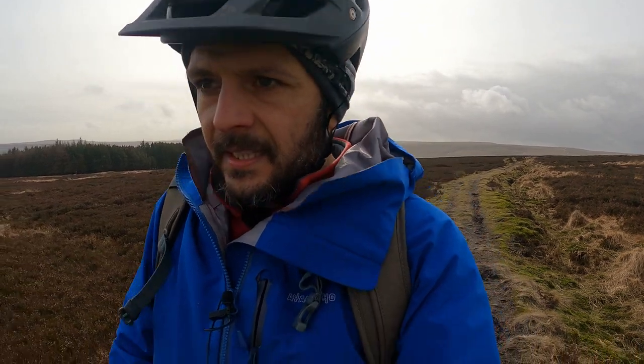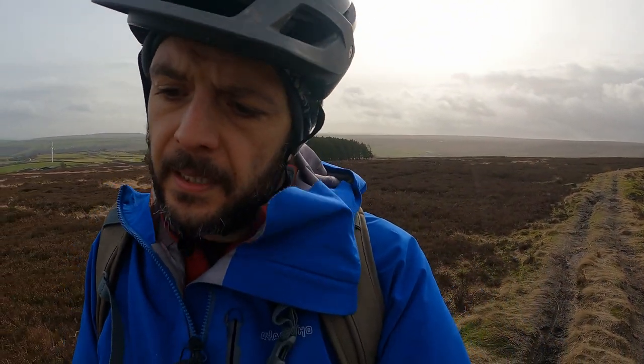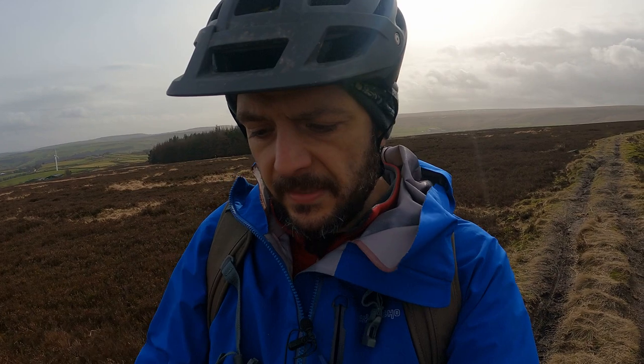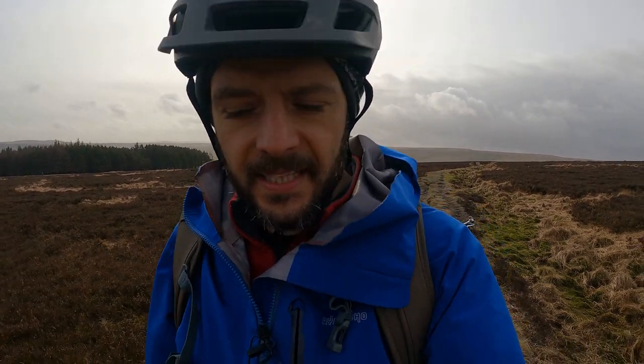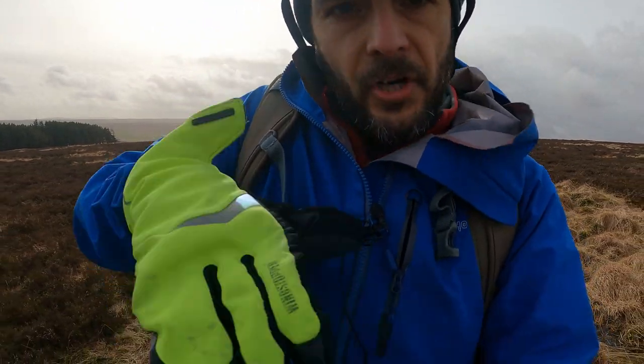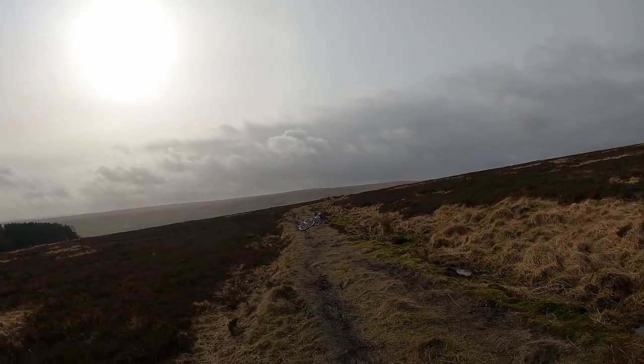You can probably tell when I'm riding that the saddle is just maybe a touch too high — I need to change that when I get back. The handlebars are also a touch too low for off-road riding. It's okay if you're racing or out without bags, but when it's fully loaded I just want those handlebars about an inch higher. I notice that when I put my hands up it's a lot better.